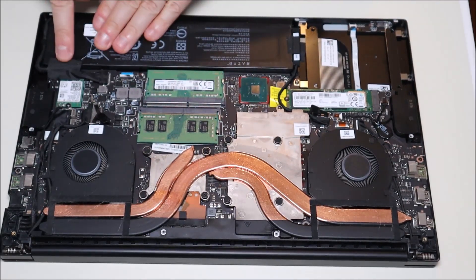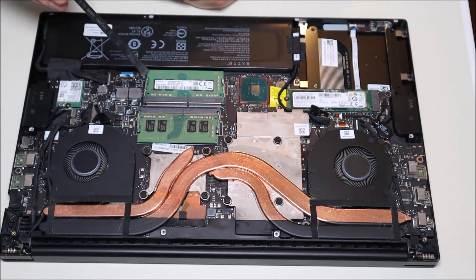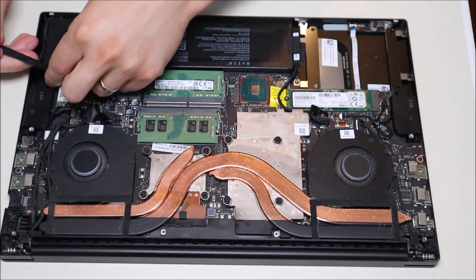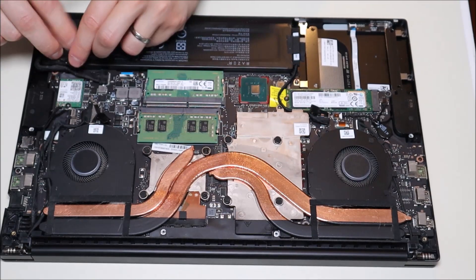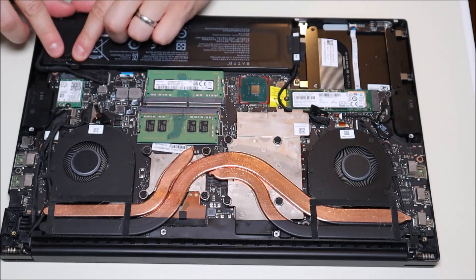To get out your battery, there's a piece of tape holding it here. I'm going to take my plastic pry tool — as often as you can use plastic, use plastic so as not to damage anything. I'm going to take that tape up very gently. Whenever there's tape, it's usually there for a reason, so try to save it. After the repair is done, we want to put that tape back down where we got it from.